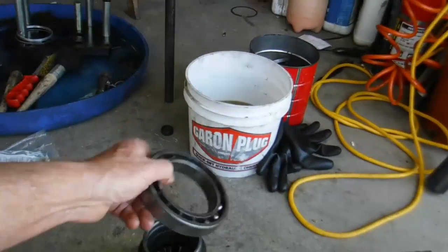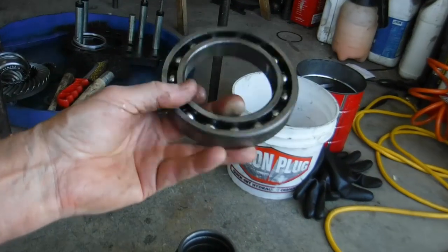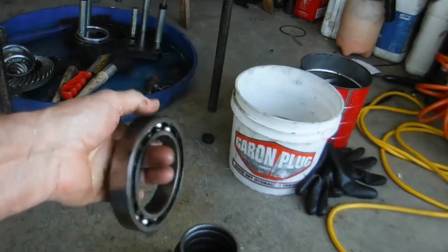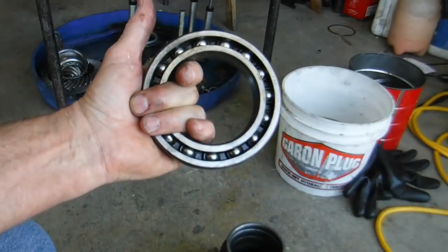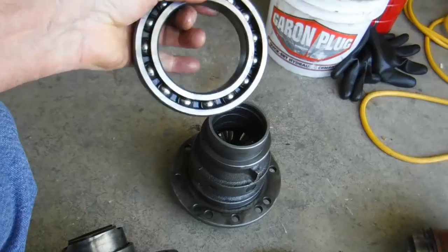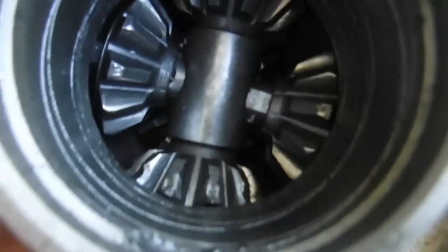With a swing axle, it has bigger bearings on the sides, such as this right here. These can also get rough and chipped — if you hammer it or something bangs into something, tolerances open up after years and years of driving. And this happens to be a super diff, a snap ring super diff, and you can look down in there and you can see it's got four spider gears.